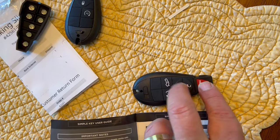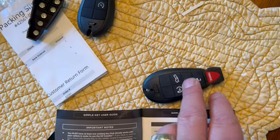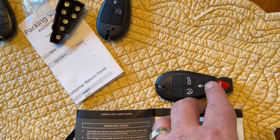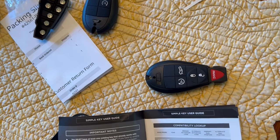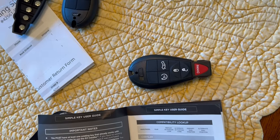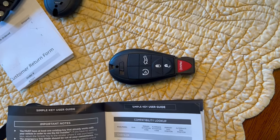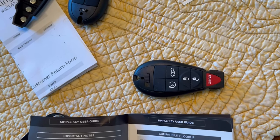You just push panic and lock — a blue light will come on — and then enter your code: 311. Push the lock button three times, panic button once, and lock button once, then push and hold panic and lock again at the same time. If there was a light it would repeat that flashing, but in my case there was no light even in complete darkness. It did seem to work when I programmed it, so I may have gone through an unnecessary step. I went ahead and did both fobs, and now we go out to the vehicle.